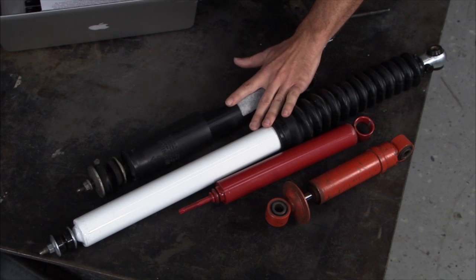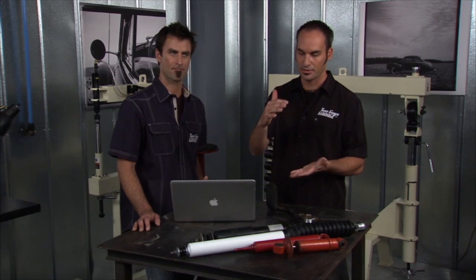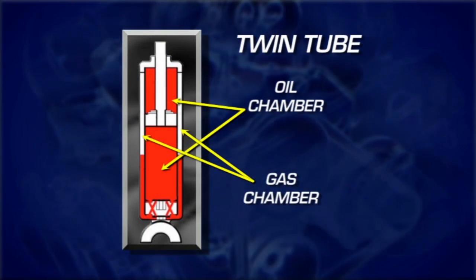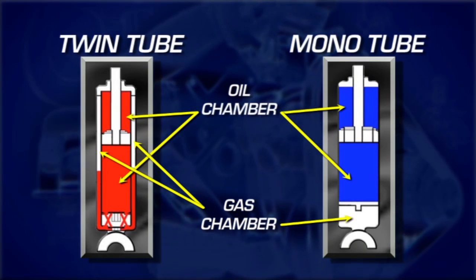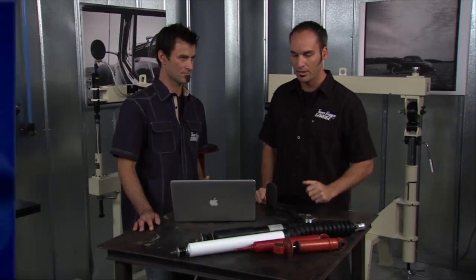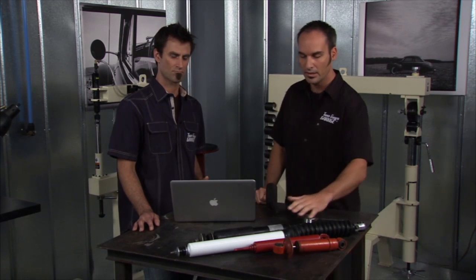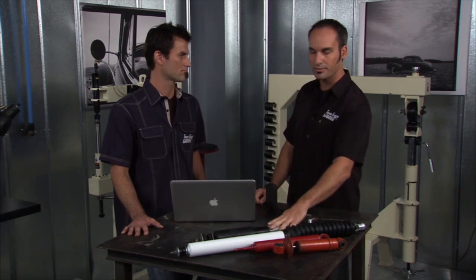From the outside they look pretty much the same. The twin tube has an additional tube inside. It's about the relationship of where the fluid goes and where the nitrogen charging is. On the twin tube, the nitrogen and the fluid are in the same chamber — as that piston moves up and down a lot, you can start to get some aeration. The mono tube separates those, so no matter how much working you get off-roading, you won't get aeration or degradation. So if you're really going to beat on it, go with a mono tube. If you're going occasional family and groceries, stick with the twin. Good question, Chuck G.